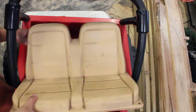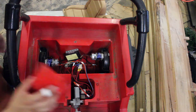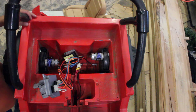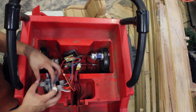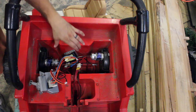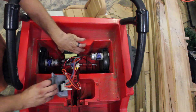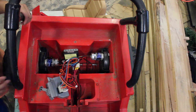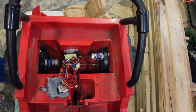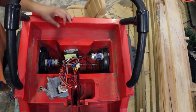In the back there's the standard seat — I've already taken the screws out for easy access. I have new motors and a speed controller back here. The wiring from the batteries comes back here similarly. I didn't want to change this series of switches, so my idea was to put a 24-volt speed controller back here. That would allow my son more control over acceleration — not just an on/off switch but more of a gradual pedal action. I was hoping that would decrease wear on the gearing from the motors to the gearbox.